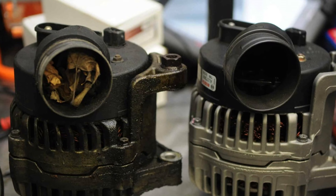If the figures are different — if it's not charging at 14 volts when you start the car or 14.7 volts when driving — the problem is probably with the alternator and you need to check the charging system.